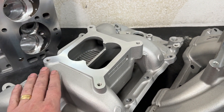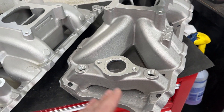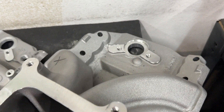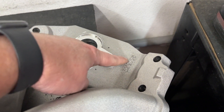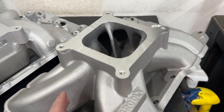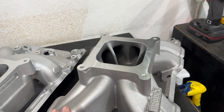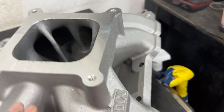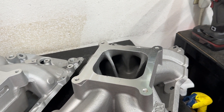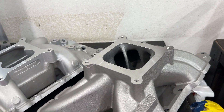I want to be upfront — there's absolutely no incentive for me to show either way, and I would never do that anyway. I always want to tell you upfront when I've got stuff. This one I also paid retail for, and this one is going on the 317s. Here's the catch though: I got the wrong one by accident, so hopefully by the time we get to the dyno I'll have the correct one. What this is, is the Brodix new single plane manifold — they've had it out for about a year. Part number is BM 2006 — do not get that one, that's why it's the wrong one. It should be BM 2000. The 2006 is for a 10-2 deck, that's the problem. But the other one looks exactly the same and will get tested on the 317s. I love the design — I've never tested it, it's a much taller one than your 454Rs. Both manifolds are 4150 flange, and I might even test with a Dominator carb using an adapter spacer, which has been really successful on the small blocks.